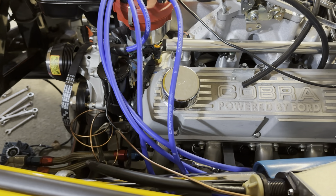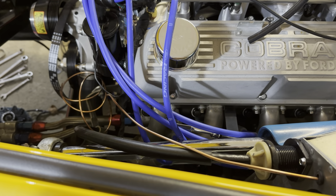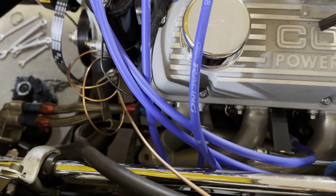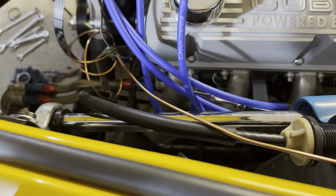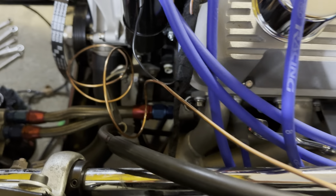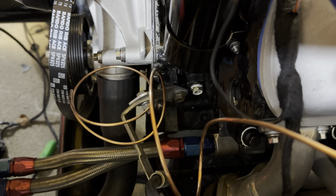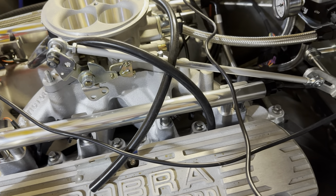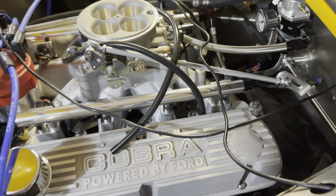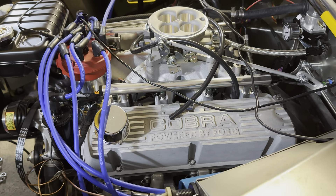The first thing I need to address is the other end of the oil pressure gauge piping. You can see this copper piping coming through. What I need to do is get it cut to length and routed. I'm going to kind of attach it to the clutch cable there because that's a pretty good solid anchor point — should keep it off of anything that might damage it. Then I'll get it hooked up and installed in the engine. You can see the fitting and the white sealer on the adapter fitting. I'm also going to sheath it. I have a length of silicone hose — the same stuff I used on the underdash side — to protect it, so it doesn't get kinked or damaged.